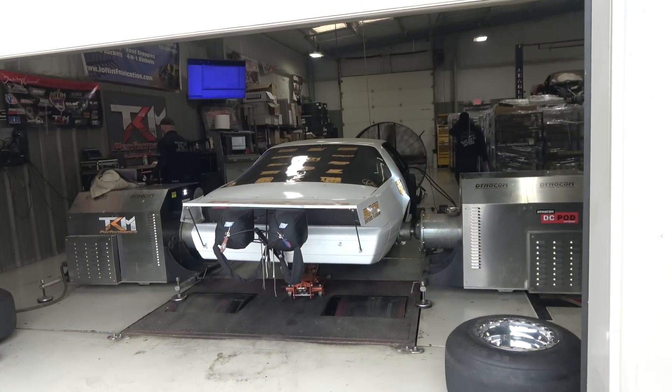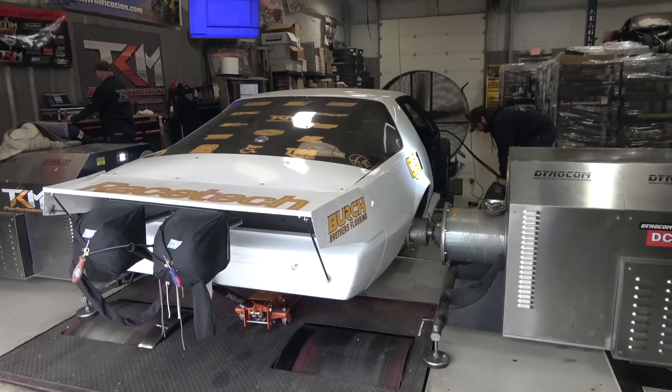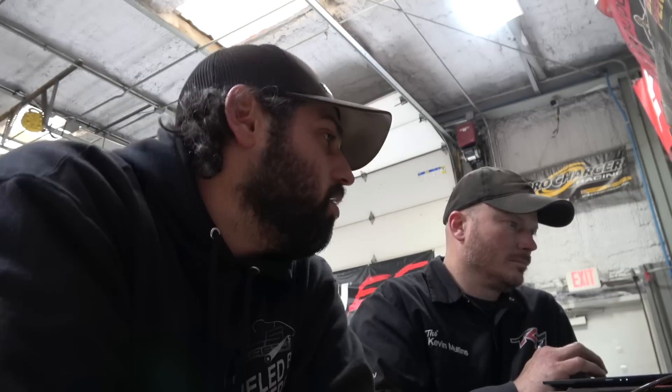It's getting a little spicy in there. Going over the data log with Kevin — very similar to the old pulls we were making. You click the button and it's super labored. Normally when you let go of the button you get that big swing up in RPMs, the converter starts to couple, pulls the motor back down a little, and then you rock and roll. But this is pretty much a straight line — gets up to 4,800 RPM on the chip, clicks the button, and instead of rolling over it just flat-lines to about 6,500 RPM. We don't really have a lot of power in it, but it's just acting like it should be able to drive right through regardless. We're in the problem-solving stage now.